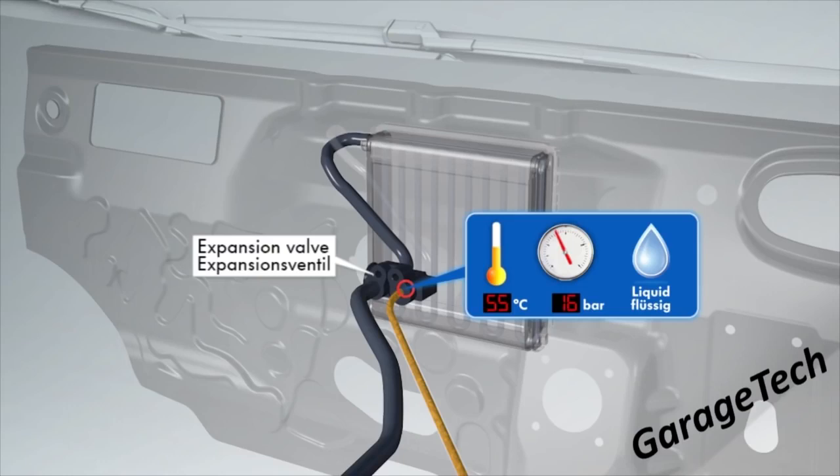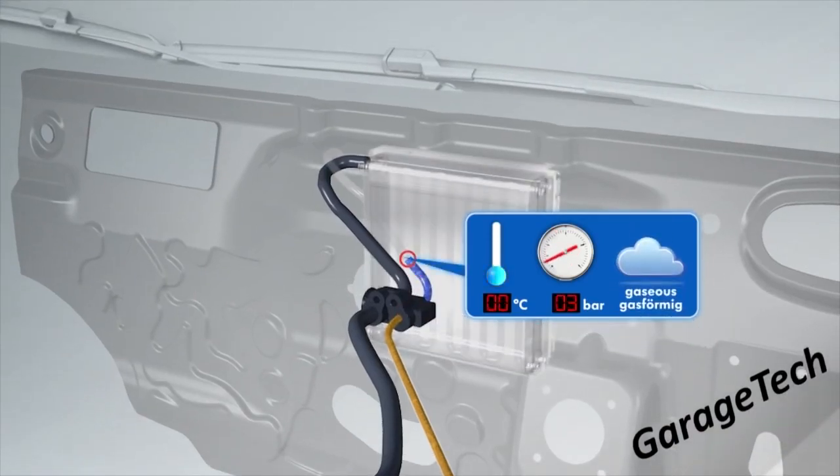On the low pressure side you should be running between 1.6 to 2.2 bar, which is 25 to 30 PSI. Inside the thermal expansion valve is a very small hole adjusted by a wax thermostat. All you need to know is that small hole changes the pressure from the high side to the low side. As the liquid escapes through that small hole it immediately turns into a gas because the liquid is able to boil immediately. This boiling drops the temperature, turning it into a gas vapor — and this is where your cold air comes from.